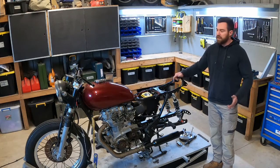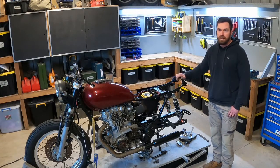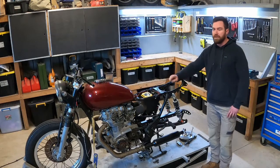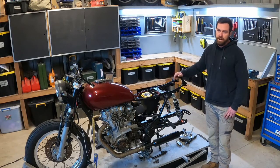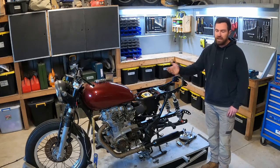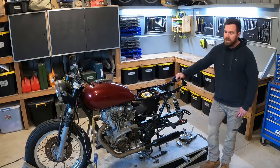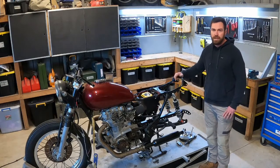As I probably mentioned in a previous video, I did buy a solid state regulator rectifier. The ad said that it was a plug-in option for this bike — it wasn't. With the bike in its current configuration one of the brushes is grounded, but to work with the new solid state regulator rectifier I had to unground one of the brushes, which I figured out later. I didn't do that; I just trusted the ad, hooked it up with the bike in its current configuration, and it blew up. I won't go into that because that's its own saga.